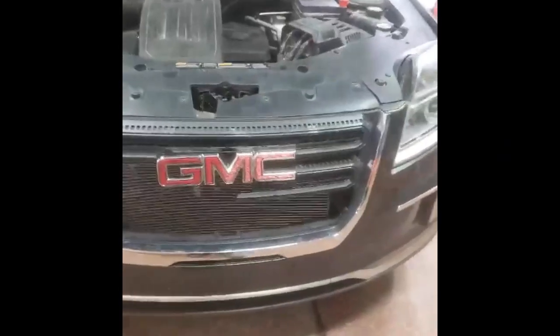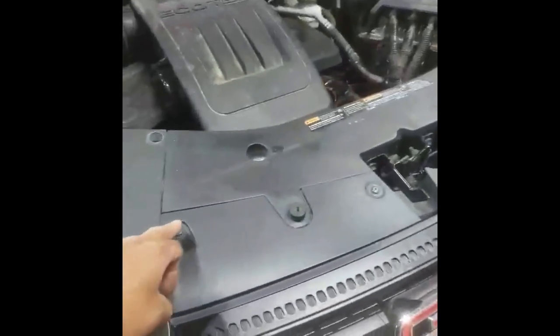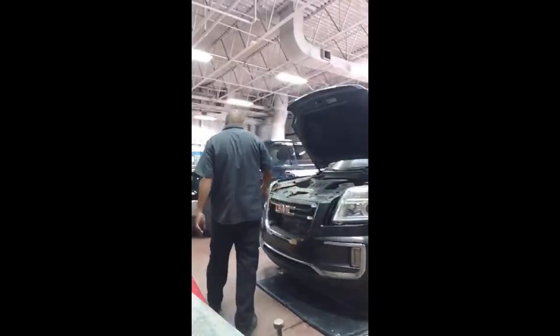First thing, guys, scan na natin yung vehicle. Second thing is, remove all the screws. Torx 15 on top, those plastic clips, Torx 15, okay, and then 7mm inside, and then the bottom, there's two 7mm right there, and then once we remove this, we can replace the AC condenser.